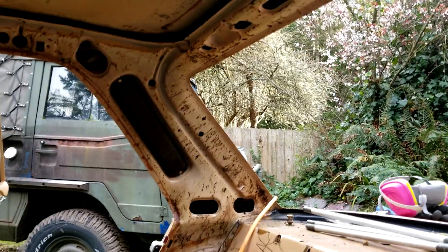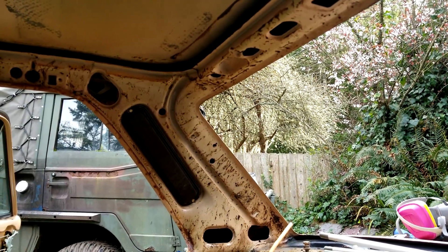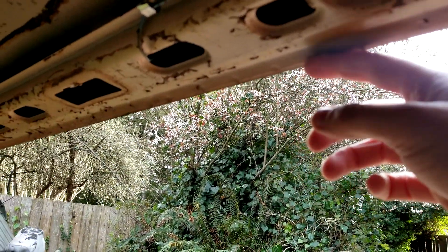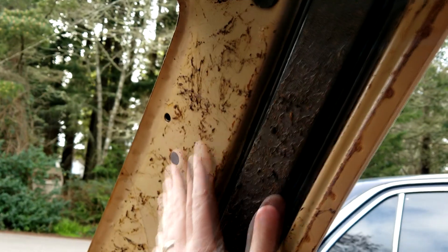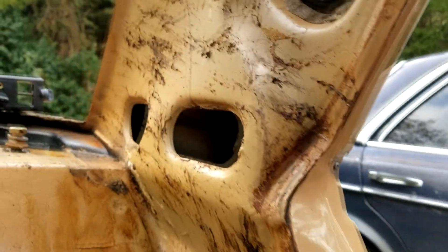I'm probably gonna use this for most of it. In one of these cars, you pretty much have to have both the front and rear windshield out to get it perfect, because the headliner goes under this lip here. The headliner also gets clipped in — it comes all the way down this piece and kind of gets clipped in along the edge with the trim piece. In the front, it goes underneath the rubber for the front windshield.